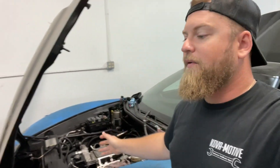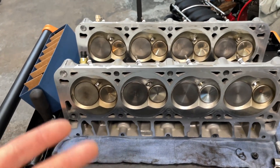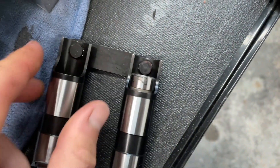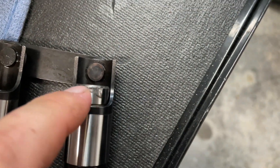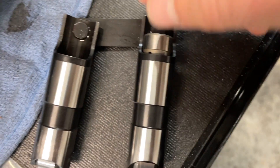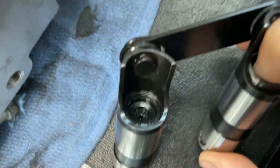This did not do that. The car ran for almost a half hour at idle and it almost started to run worse and worse. So we have our heads off the car, pulled all the lifters out. While I had them out I wanted to inspect them. I took this one pair here — this one on the left is still assembled, this one on the right is disassembled. I pulled the snap ring off and the little ball seat out. On this inner piston, you can see that the coating or finish on here is damaged. If you twist it around, this is how it's supposed to look — nice, smooth, not damaged like this. I can actually feel it with my nail. The damage is very prominent and you don't see it when it's inside because it's all compressed and held down with the snap ring.